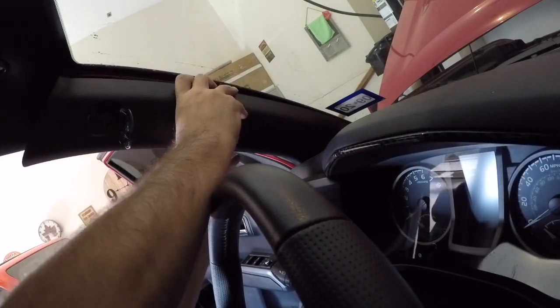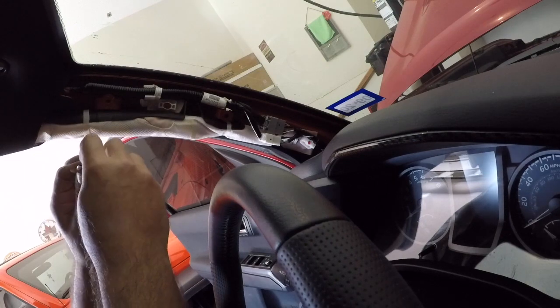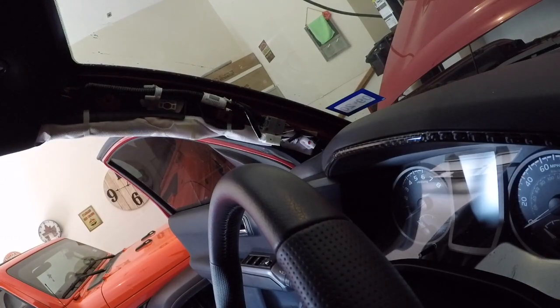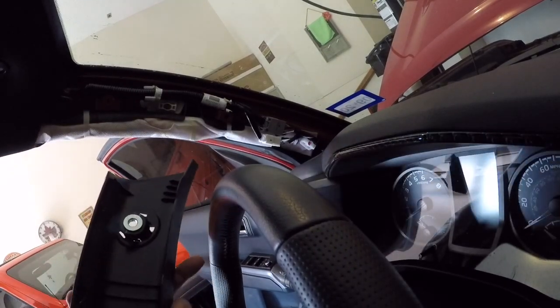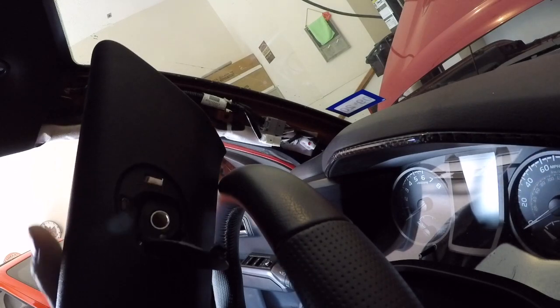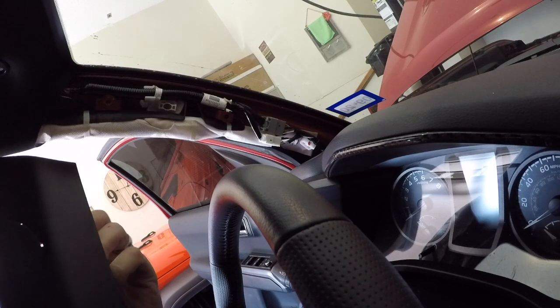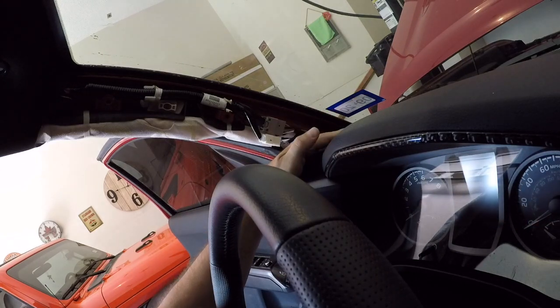Something fell off in there — I'm guessing that's where the bolt goes in, so watch for that when you pull the piece off. There it is — the little bolt retainer. It fits behind this trim piece here. If yours falls out, make sure you grab it and put it back in. You can see it in there — that nice shiny part. It just pushes back in. Set that aside, and now we have to remove the trim piece that covers the speaker vent area.